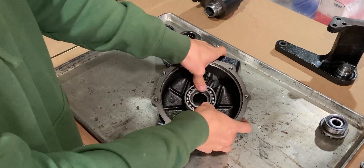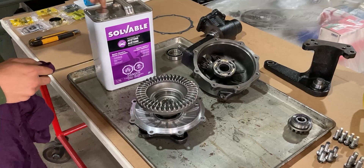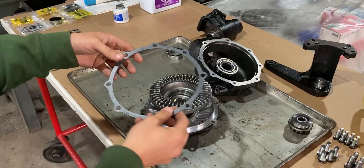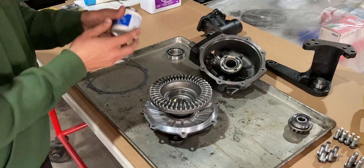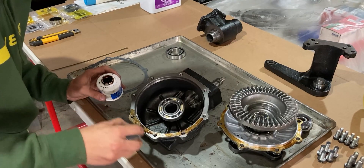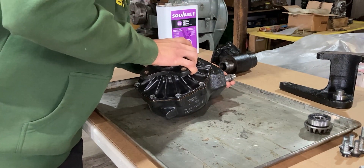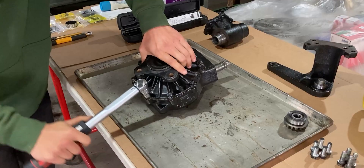This bearing will allow the gear case to pivot once fully assembled. With all parts where they should be, it's time for the grand merge. But before that, I'm giving the mating surfaces a good clean with acetone, removing all the oils. Now, laying down this gasket from John Deere is not rocket science — it only goes on one way. To ensure a leak-free assembly, I'm applying some aviation form-a-gasket on both sides. Trust me, this stuff is really good.